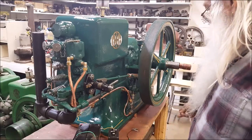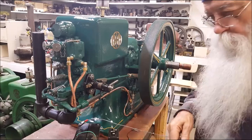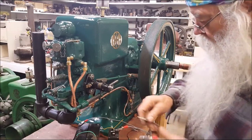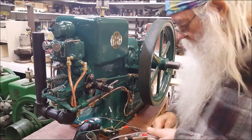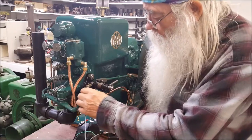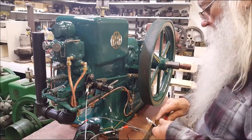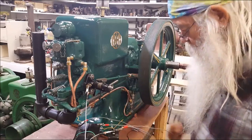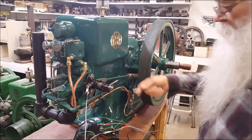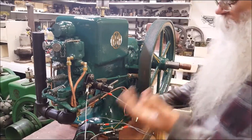To explain this: on one of your battery posts, put that alligator clip over there on it, then come over to the low-tension coil and put that alligator clip on either one of those posts — it doesn't matter. Then get the other one and put it on the other side of that coil, and then go to the stationary electrode on the igniter. The other one comes from the ground on the battery — I've got too many cables, don't let me confuse you. That's three cables. The other one from that ground goes to a ground on the engine, right there. That's the way you do it.